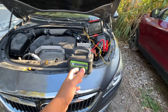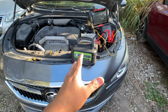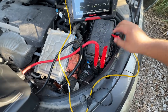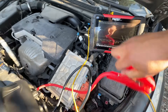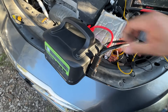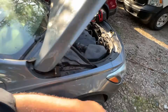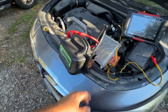At this point I realized what was happening — the charging system on the vehicle wasn't actually working. This jump pack is designed to only give you a quick boost of voltage to start the vehicle; it does not maintain battery voltage. When connected to the battery, it continuously gives it short bursts of 14 volts. I need to disconnect the jump pack, but I don't think the car will stay running long. And yes, the engine just died. The shop went ahead and put another battery in it — a used one — so I'm not sure if it's fully charged.